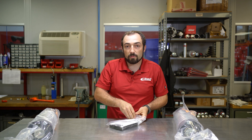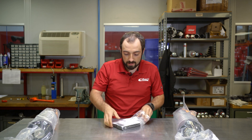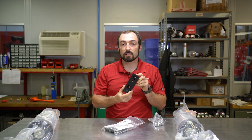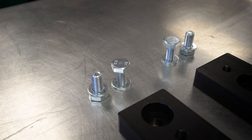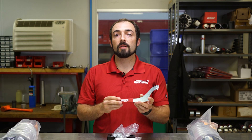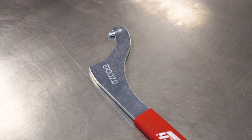So let's talk about this. We have our sway bar relocation bracket here — that's going to move your sway bar forward and provide a little bit more clearance to the spring seat. It comes with a nice aluminum machine mount and all the hardware you need to mount that up. The kit also comes with a coilover adjuster wrench, which is going to allow you to make adjustments to the kit, whether you want to raise or lower the front to suit your needs.